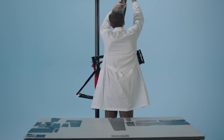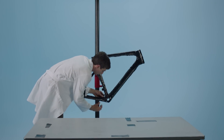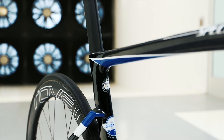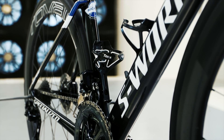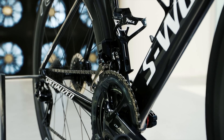Using this knowledge, we assembled different aspect ratios from the free foil shape library into locations like the fork, head tube, seat tube, and seat post — where aerodynamics we know is very, very critical. And in other places where stiffness and weight are extremely critical and aerodynamics has less of a role, like the down tube, the top tube, and the chainstays, we used a different set of shapes more optimized for stiffness and structural efficiency.